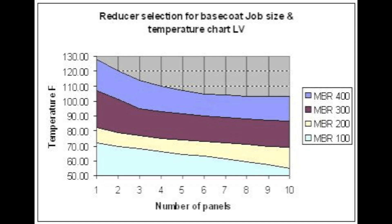They have a wider range for some of them, but they are exempt, so overall they're going to be a little bit faster. You have to watch the gun distance, as you do with most low VOC products. As a general guideline, the same thing applies — you want the base coat to actually flash out so that it has an opportunity to orient the metallics properly, achieve the right color, level out and adhere well, and provide a perfect surface for the clear coat to go on.